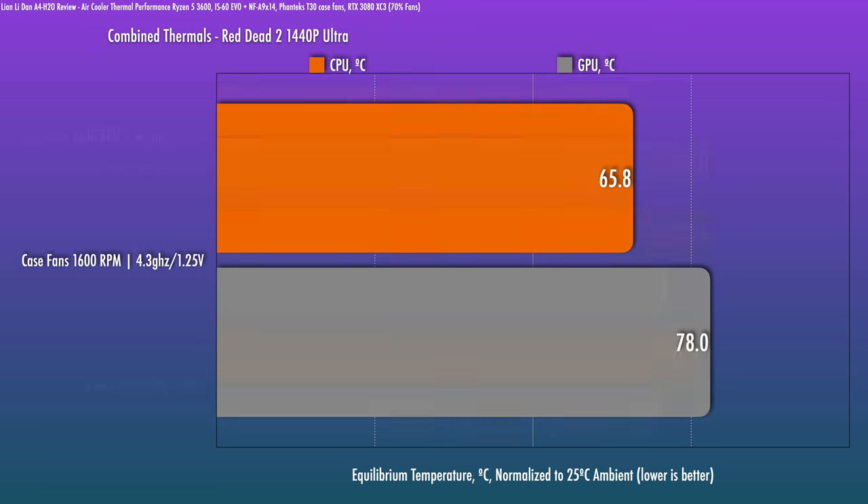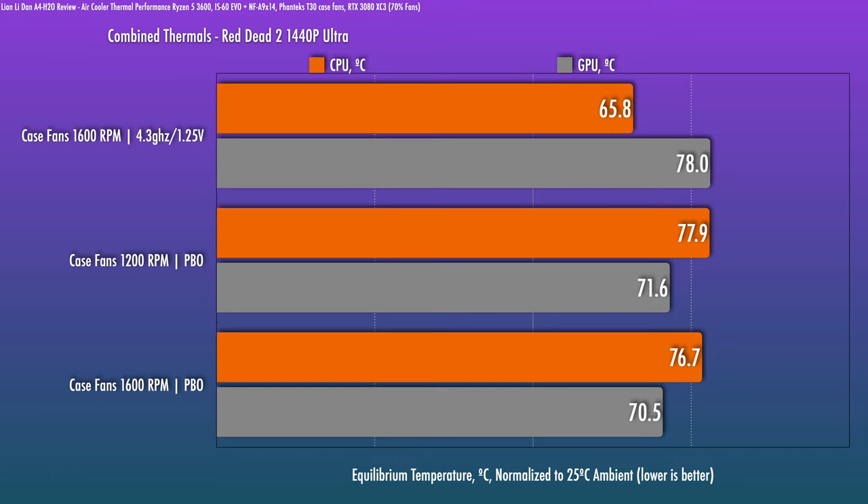If we look at the temps with PBO, you'll notice some very different results — cooler GPU, hotter CPU — and that's going to be misleading. The GPU temps didn't all of a sudden become amazing. What's actually happening is that, at least with the stock 3600, it's only boosting to 4075 MHz on all cores, which isn't unexpected with a smaller cooler, but it's definitely not fast enough to allow the GPU to run free. While you'd usually see around 335 watts of GPU power draw on this 3080, because we're CPU limited here, it's only coming in at 280 watts — so utilization is not 100%, and it's much cooler.